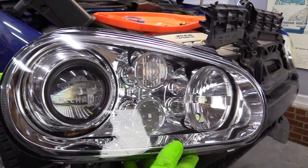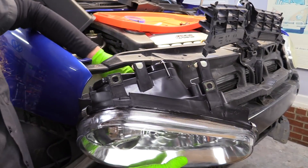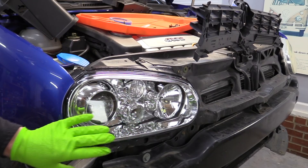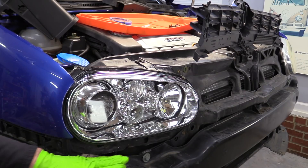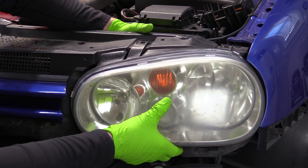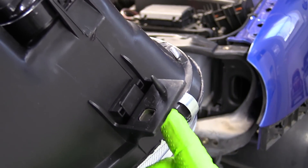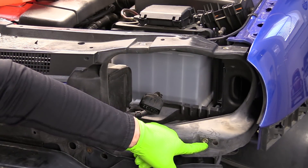Here is our brand new fresh headlight. Remember, it's just plug and play, so we'll plug it in and nurse it into its place. I like to start the top bolts first, then the bottom ones. Normally, I'll leave them a little loose so that if we need to make any adjustments, we can do that. We're going to have to also check the alignment to the fender and the bumper cover. Now, notice that our new one also has these alignment dowels right here — this is where the screw goes. You want to make sure that these line up to the holes right next to where the screws go.